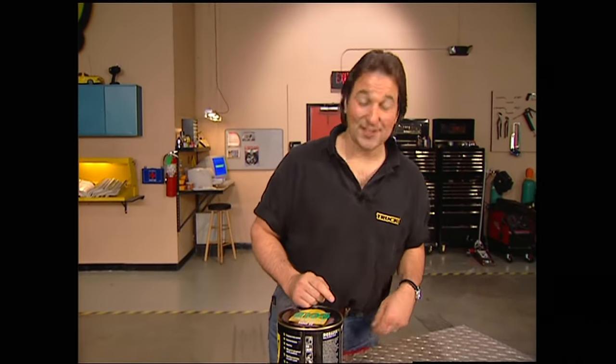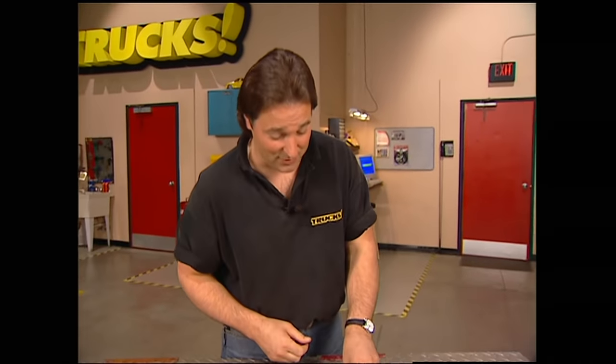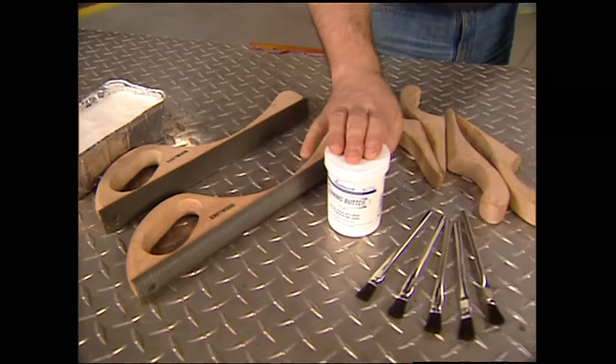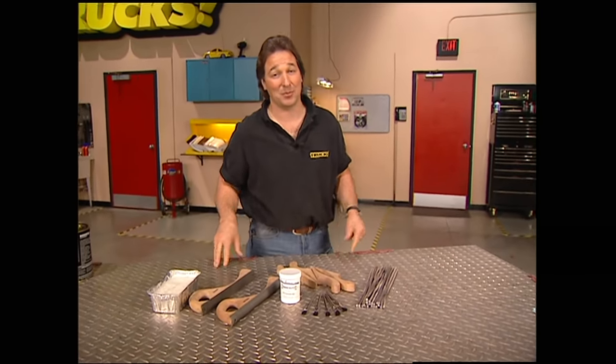Speaking of custom bodywork, since the 1960s the filler of choice to smooth everything out has of course been plastic body filler. But before that came along, all the great customizers used lead, or body solder as it's called now. Unfortunately, working lead has almost become a lost art — which is too bad, because there are times when it would be really appropriate, like in high-strength situations around doors and windows, or for purists who wouldn't dream of putting any plastic on their classic truck. The Eastwood Company's body solder kit comes with tallow, a couple of files, tinning butter, wooden handles to smooth the lead out, and the lead bars themselves. If you're serious about your bodywork, you need this kit — the price is $120.